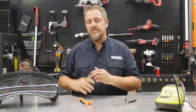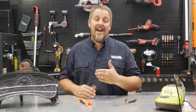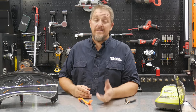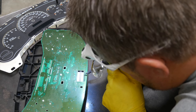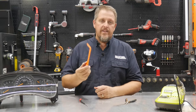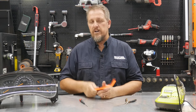We'll walk through the removal and then get into actually dismantling this and finding the broken solder joints we figured we'd find — though they were a lot harder to find than you'd suspect. I definitely recommend some magnifying glasses; you can pick them up on Amazon pretty cheap with an LED light, which will help illuminate what you're looking at. A little plastic pry tool is very handy — stay away from a metal one when prying off those needles.